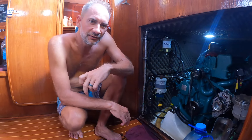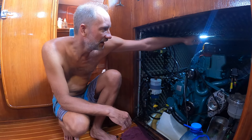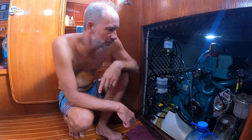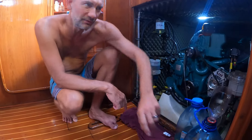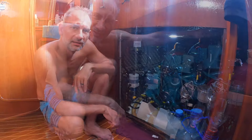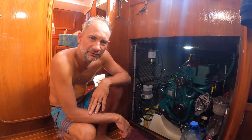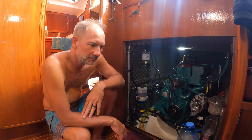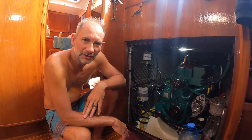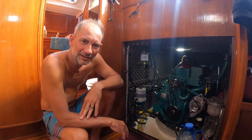To extract the engine oil I've got a little 12-volt electrical pump. You just hook it up to the battery, put it into the dipstick or oil extraction tube, and the other end into a bottle for the used oil, but it's pretty noisy. The D250 or D255 has about 10 liters of engine oil, so it's quite a lot to extract. This little pump goes very slowly and you can only run it maybe half an hour at a time, then it gets a little bit warm so you need to let it rest.